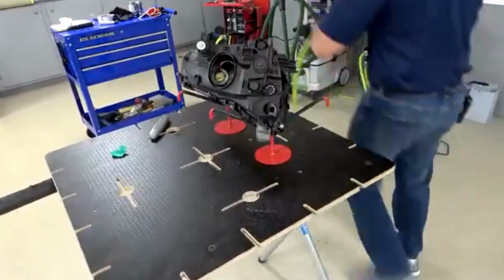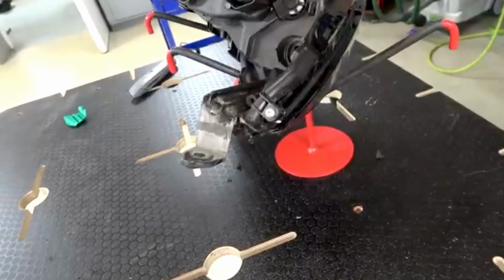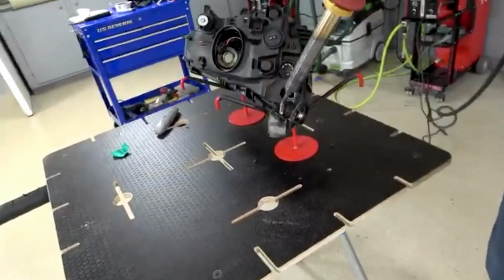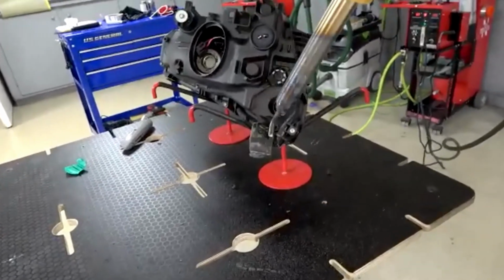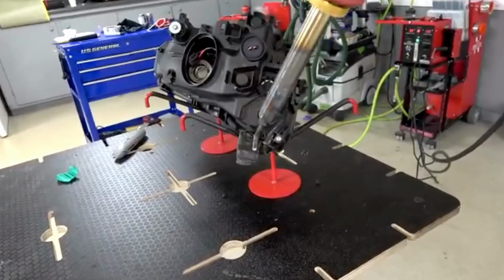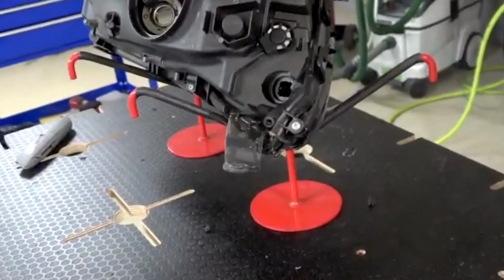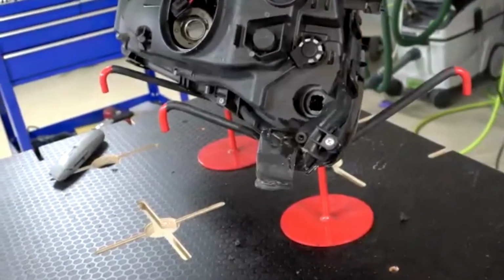So what I did was I used a Roloc disc to grind off the slag and then used 80 grit on a sander to get rid of those sanding gouges, sanding scratches, excuse me. Now I'm gonna take my nitrogen welder, blow some heat over my repair, and remelt that fuzz. And yep, smoothing that fuzz down, just making it look a little nicer and neater there. Backside repair complete.